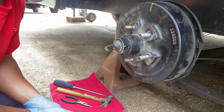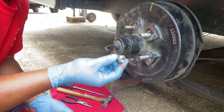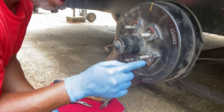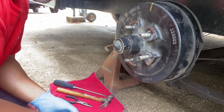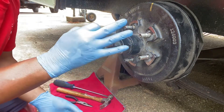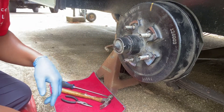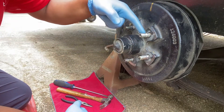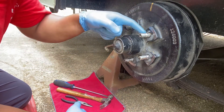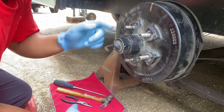This video is about why we should always check our lug nuts for the right torque on your studs to your trailer. What happened was the lug nuts were loose and the wheel rim was riding up against the stud itself. The wheel rim cut grooves into the stud where the thread is — as you can see, it's real shaved off and shiny. It's cut down into the stud on all five studs.